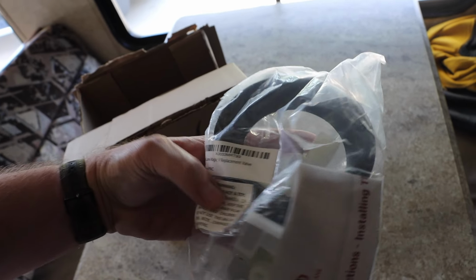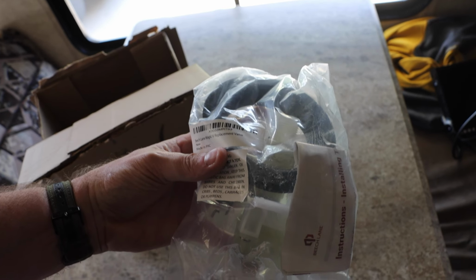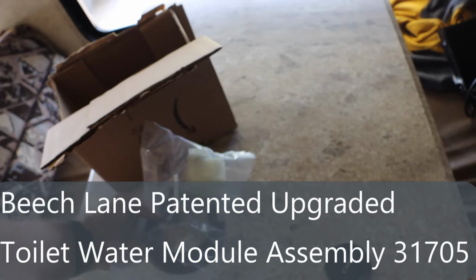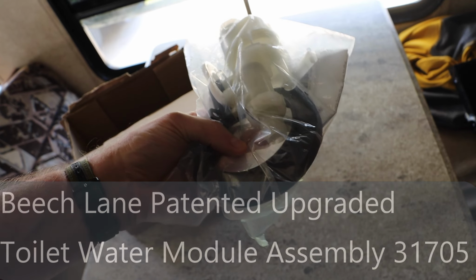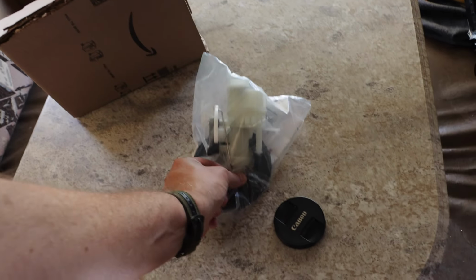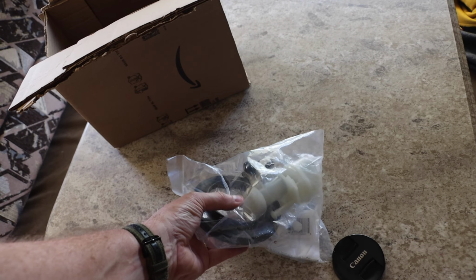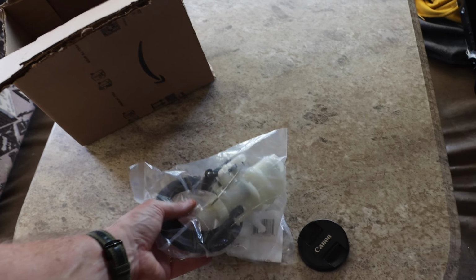We came to determine that it's actually the valve leaking on the Thetford toilet that we're going to be replacing today. Alright, I ended up picking up this kit at Amazon. I'll put the link in the description down below, but it actually has the replacement valve. One thing common that we've seen on these toilets is that the valve, the threading, the plastic and all that over time can crack and leak, and I think that's the problem that we're having with ours.